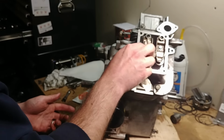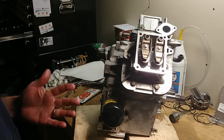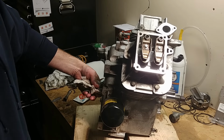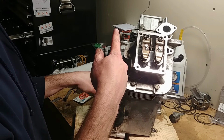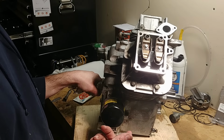I think the fault this guy had here was he didn't find top dead center, or I don't know if he even looked, if he just threw them in and thought he could set them anywhere. You need top dead center of the compression stroke so that you're on the round part of the lobe. These camshafts have a compression release built into them.